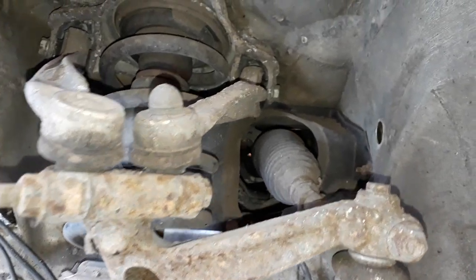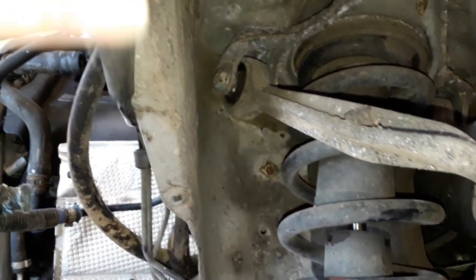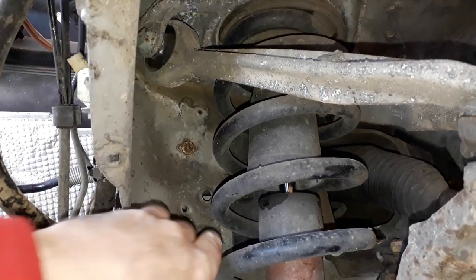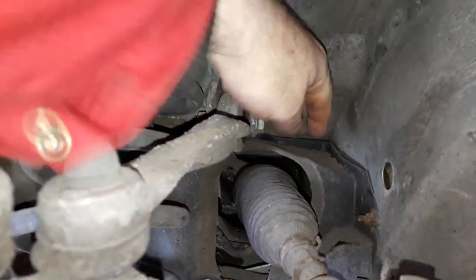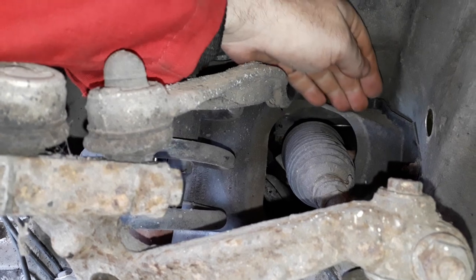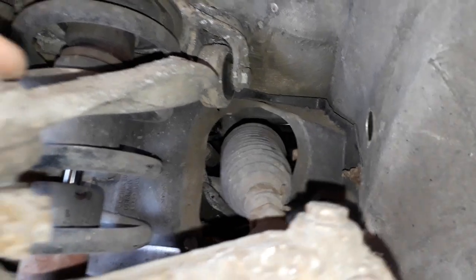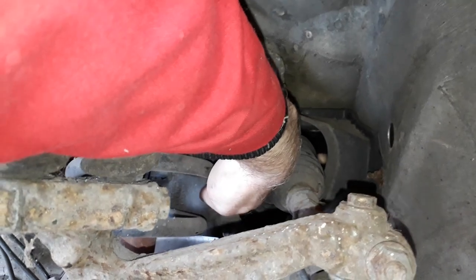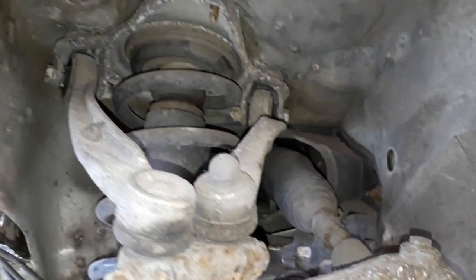The wheel removed, I can now get better access to inside the wheel arch. And right at the back, I'm hoping you can see, this is a plastic dust shield. There's a corner there, and here's some of it here. Okay, now it looks like if I can remove this, I don't think I can take it all the way out of the car because the steering rack has to be removed to do that. But if I can undo this to a point, I might be able to get my hand down here where I can then reach the rest of this wiring loom. So here goes.